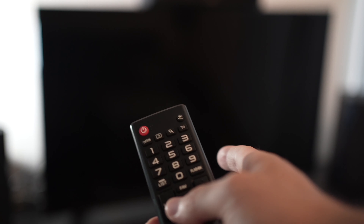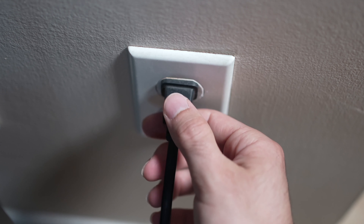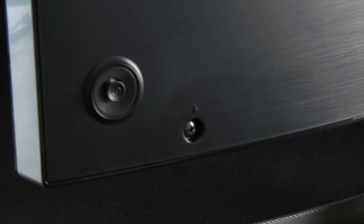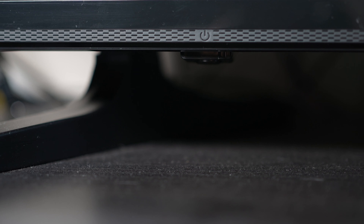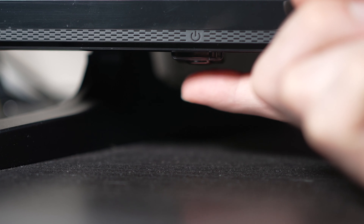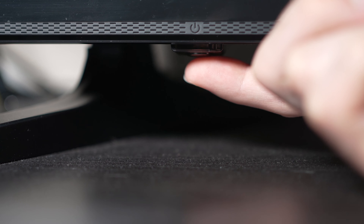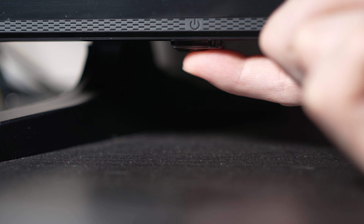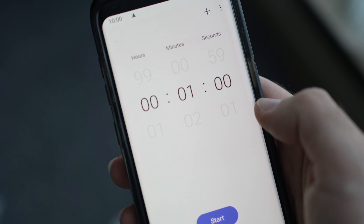This won't erase anything. Turn your TV off and unplug it from the wall socket. Now depending on the model you have, you may have a power button on the back or one on the front under the TV. If you don't find one, just skip this step. But if you found one, keep it pressed during 30 seconds. Then you have to wait a full minute.